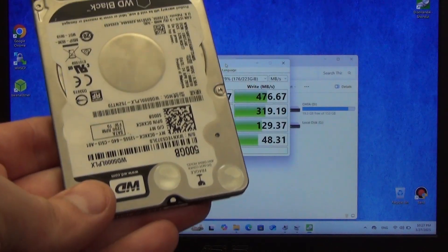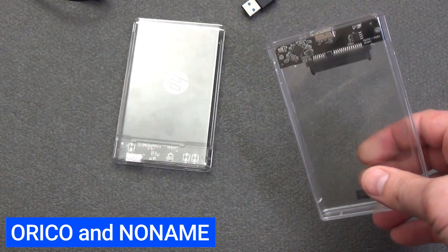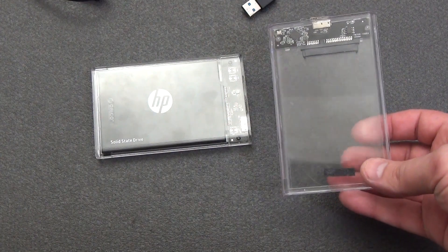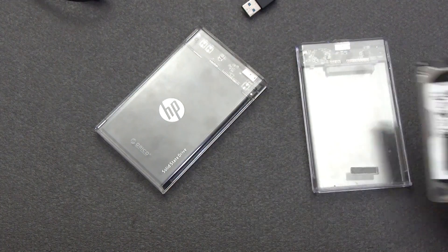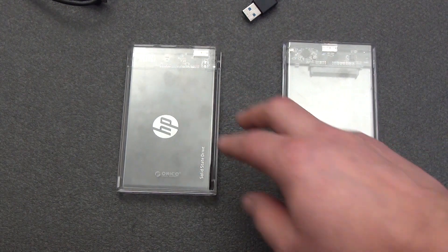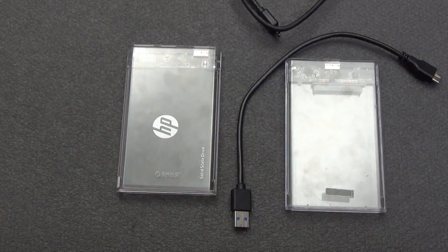The speed of the hard drive will be lower, but this is a feature of HDD technology versus SSD. The controller of our adapter pocket itself performed perfectly. I have been using such cases for quite a long time, and now I want to show you the difference between a case from a trusted manufacturer and a case from a no-name manufacturer. I bought this no-name case quite a long time ago and it served me well, but what made me include it in the video is the speed. It seems like nothing special when talking about a hard drive — the speeds are the same. But with SSD drives, the Orico gave 457 megabytes per second reading and 439 megabytes per second writing. I'll move the SSD into this no-name case now using its included cable. I tried changing the cables and it doesn't affect the result, but the controller itself does affect the result, as you'll see.